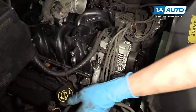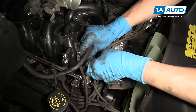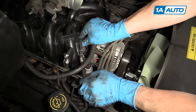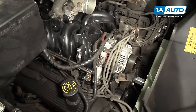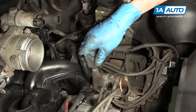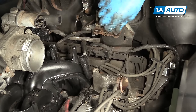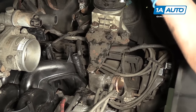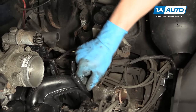The two temperature sensors right here need to be plugged in next — we just folded the harness out of the way when we took it apart, so put them right back to where they belong. You'll hear it click as soon as it's on; give it a little pull to make sure it's snapped on. Now we have this power steering bracket that goes from the power steering reservoir over to the thermostat housing — we'll reinstall that. Take these bolts that we put back in place so we didn't lose them, and put the bolts right back where they belong. They are eight millimeter bolts, so we'll use a ratchet and an eight millimeter socket to tighten them up.